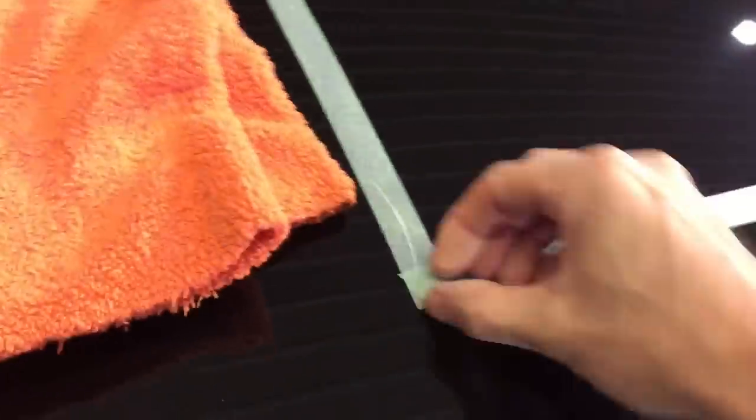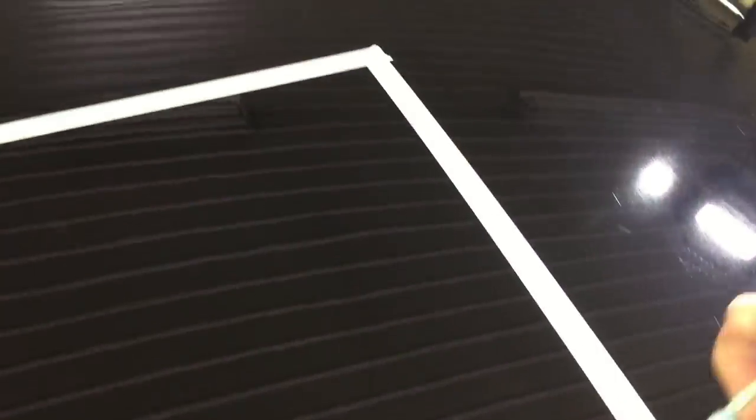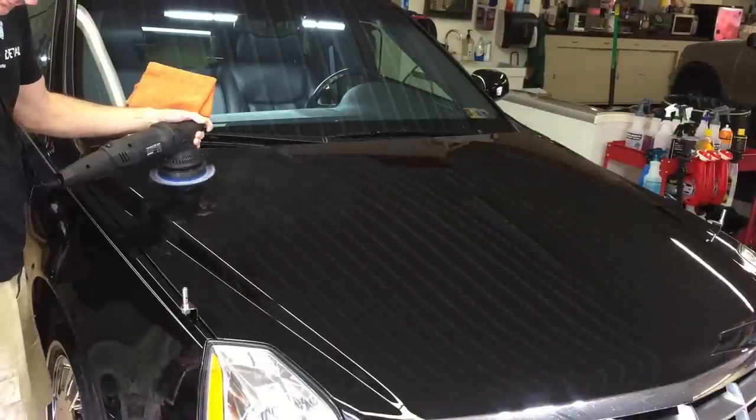When it comes to wiping off the residue, out of the sunlight it comes off rather easily, especially while using a QED. If the QED is absent and you're in the sun, it gets quite hard to wipe off. That said, you're going to see this section - it does a fine job. This is hard clear coat, one pass, and it's done exactly what I wanted it to do. It just left behind a little bit of hazing that we can clear up later with a polish. That hazing can be cleared up with the M205, though I have products that do a slightly better job.